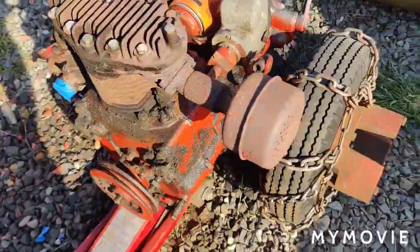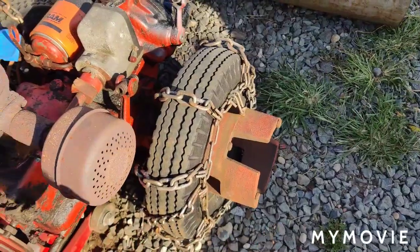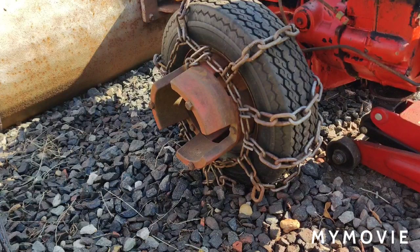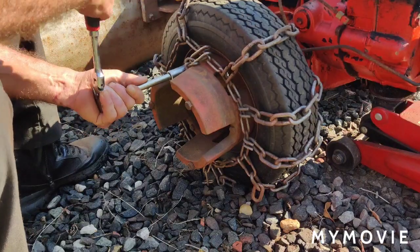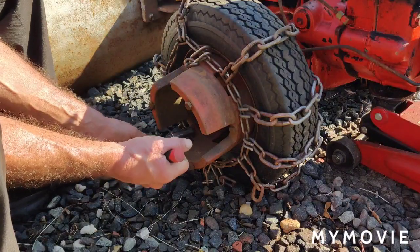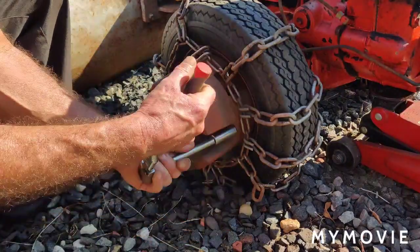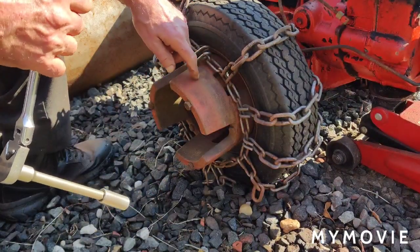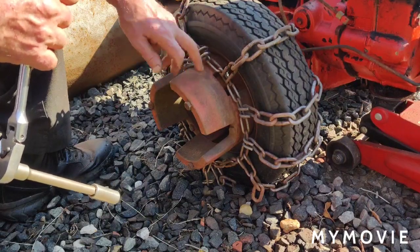What I'm going to do right now is finish disassembling — I'm going to pull the spacers and wheels off. Before you jack it up, you want to loosen your lug nuts or bolts first — same principle as on your car. There's a wood chipper in the background making noise, so I apologize for that. What I'm going to do with the spacers is use my degreaser, brush them down real good, and I think I'll just paint the spacers orange. I already did the other side.